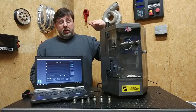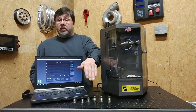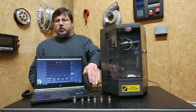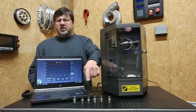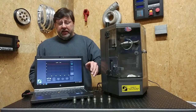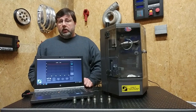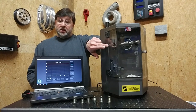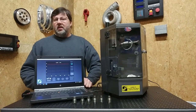If you need any of these valves modified, you can send them to us. If you buy one of these machines, we'll show you how to do these valves. This is the ultimate fix for drivability concerns, for longevity, for making injectors last. You can damage CP3 pumps with huge pressure spikes, but you don't have to do that if you know what you're doing. This is something that we developed years ago — we've been modifying these valves since probably about 2007 or 2008. And that's what this is here — we're doing a 10.6 millimeter stroker pump and a set of injectors for the customer that owns this valve.